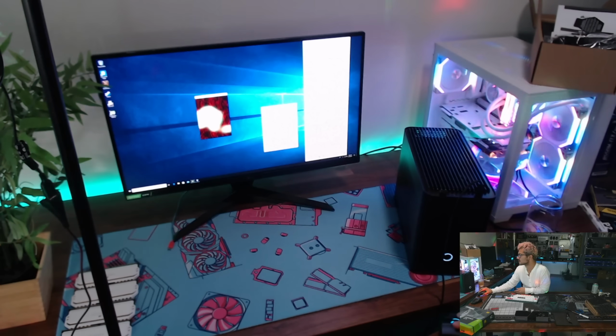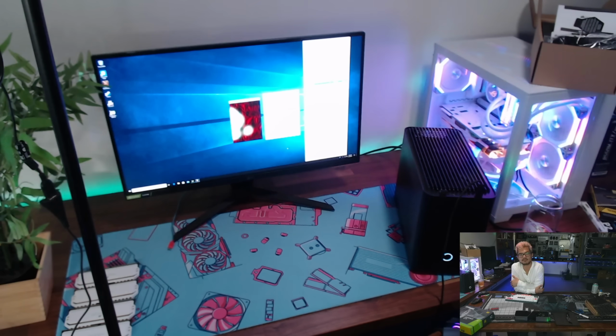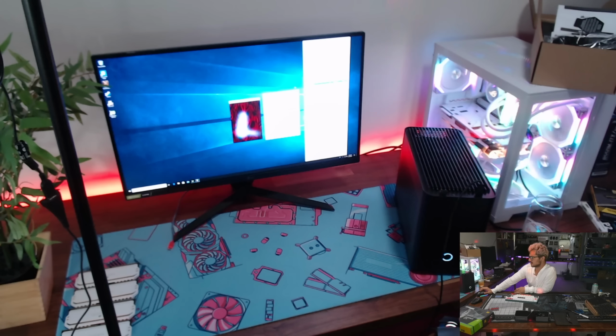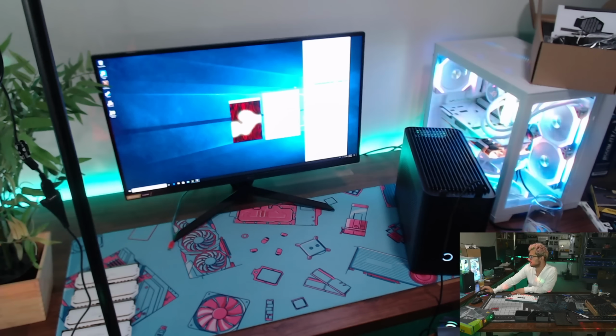All right, we're putting a load on the system now. So the GPU is at 100% load right now, like 98, 99%. And it's currently at 50 degrees C, and climbing. Meanwhile, our CPU is bouncing back and forth between idling and doing stuff in the background, so the temperature is fluctuating. Right now it's hovering in the mid 60s, sometimes hitting 70 C. GPU is now at 54 C.